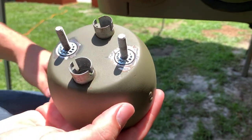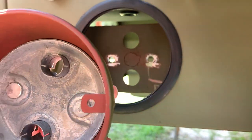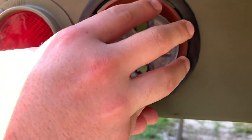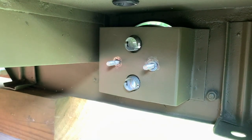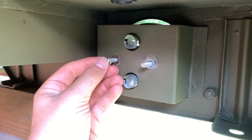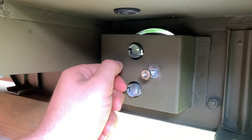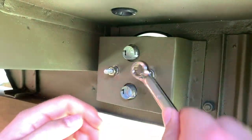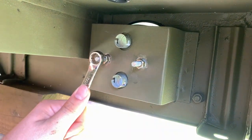After about 5 or 10 minutes of letting the sealant tack up, go ahead and take your grommet and slowly work it around the outside edge of the opening where your tail light will go. If you have a little bit extra that oozes out it's okay — once it dries you can wipe that off with some alcohol so you don't damage your paint. We'll go ahead now and install the housing. On the back side we've got our washer and our star washers, and there are two tabs that will hold the actual covers in place — those go towards the top. There's also a dimple in the bottom side of the housing where there's a groove on the cover that slips in. On the back side of the bracket we'll install a lock washer and a nut on both sides of the post — that's what's going to make the ground contact, so we've actually got double coverage making sure we've got a proper ground. Once you install both nuts, go ahead and finger tight them down, then take a 7/16 inch wrench and snug everything up, drawing that star washer and that lock washer into that bare metal. Make sure you've got everything really tight because tight and bright is what's going to make that good ground.